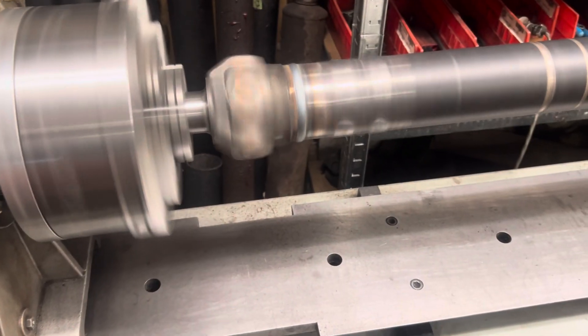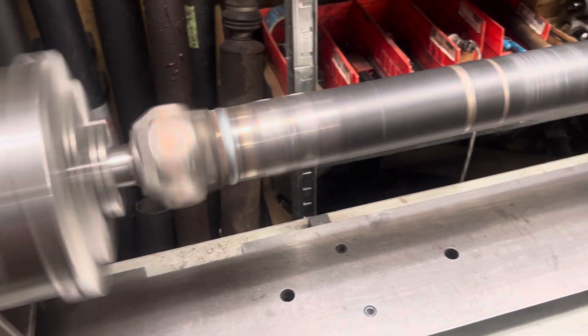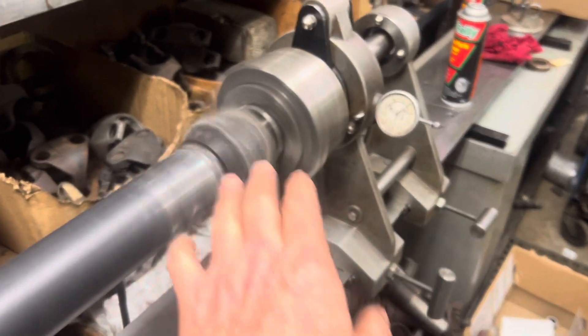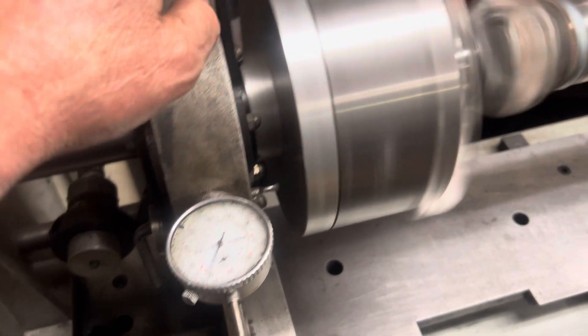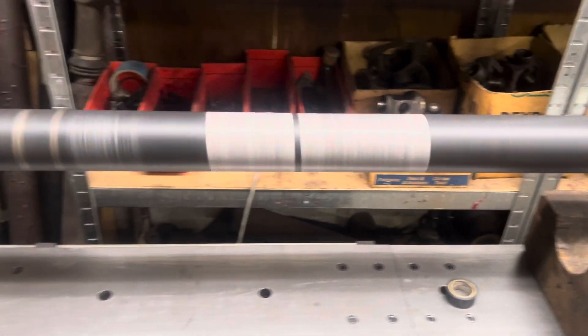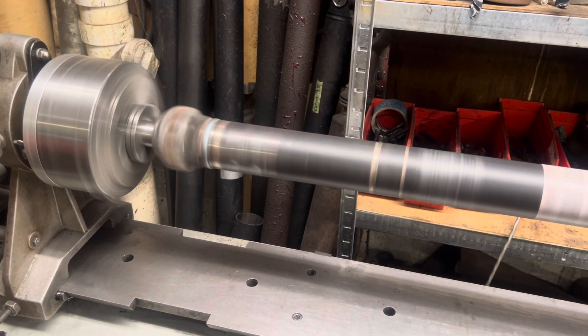Really only shortening about an inch and a quarter, and swapping the joints over to 1310. The back is the same as it was — Mechanics 3R — I re-ran the joint he had in there, and that pretty much sums that up. That's the spin at about 2800 RPM, zero at the transmission and zero at the rear axle, so this is going to be a win for Dan. I'm just going to touch the paint up on this and send it back in the S10.